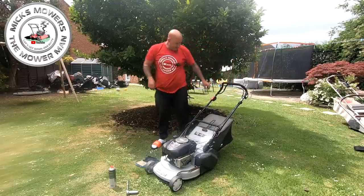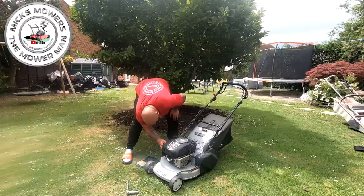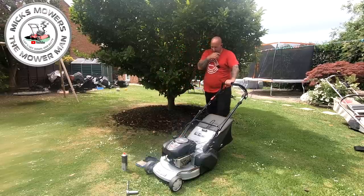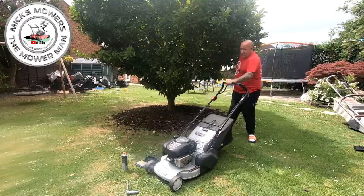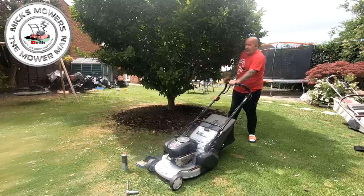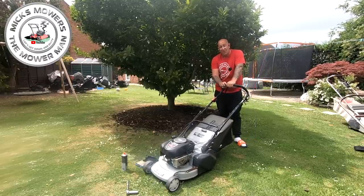I don't like it. So I'm going to take it off the choke and pour some carburettor spray straight down the throat. That should fire. No spark, no start, no issue — let's get it fixed.